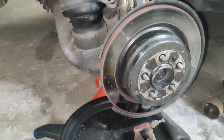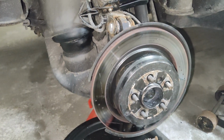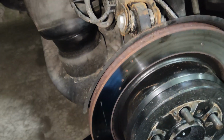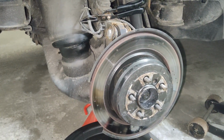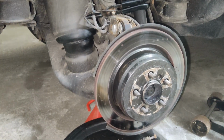New brake pads. I will put all these parts in the description for you if you are looking for new rotors. I did put aftermarket rotors on this a while back. These were the drilled and slotted aftermarket rotors. So all of this for me is in good shape, so I will leave that alone. We're ready to go ahead and put our new bracket and caliper on at this time.